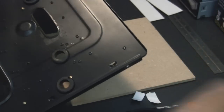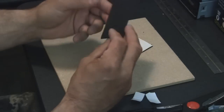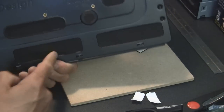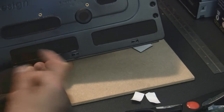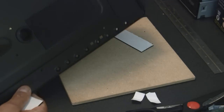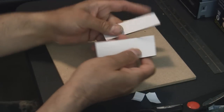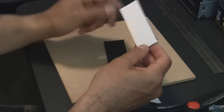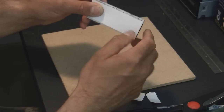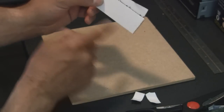The reason we need two pieces is — we want the foam side coming through on the front, but we also want the adhesive to stick to the back of the motherboard tray. So one piece will be the backing, the other one we'll trace out for the size of the hole and cut it. Then we attach both pieces together, make the slit, and we've got foam on both sides with the adhesive around the circle.